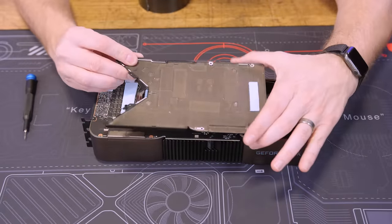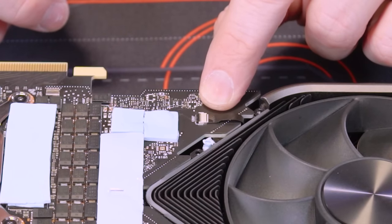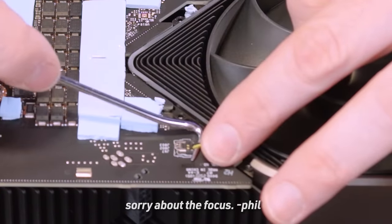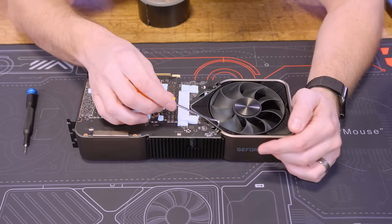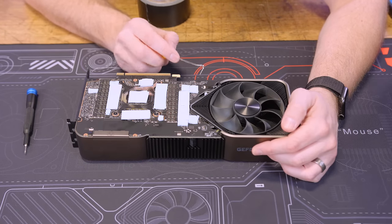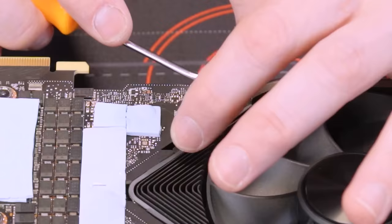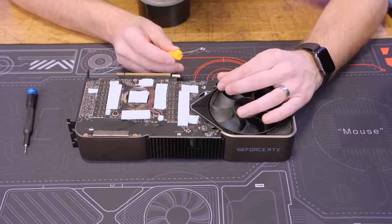So that's what the underside looks like right there. You can see where our thermal pads were making contact — they're kind of greasy and some stuck to there. Right here is a ribbon cable that you got to be careful with. And then over here it's a little slot — so that pulls back just like that, and then you can gently lift up and that releases. So that's a lighting cable. If you were to screw that up, the worst thing that would happen is your LED bar right here won't light up anymore. And then this is actually a ribbon cable for the fan. We can pull the cable straight out and that's now released. So obviously when you put the cooler back together, you got to make sure these cables are coming through their gaps where they're intended to.